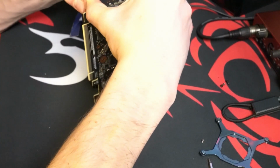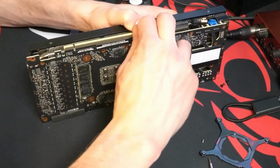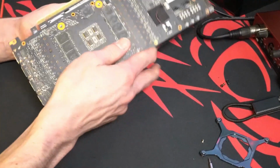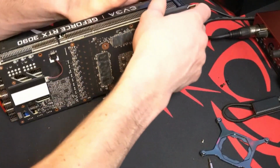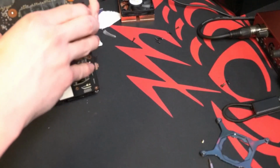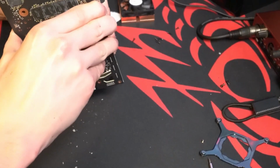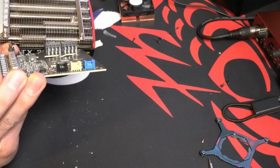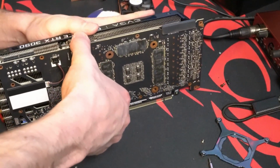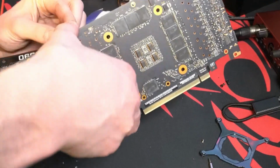And you're gonna notice there's a cable. Once you get this thing apart, you might be able to unplug it while it's together still. But when you pull it apart, don't pull it apart aggressively. Look for that cable and unplug that. You'll see me do it. I do it after I get the card detached from the heatsink. There's that little wire. You see that? The middle left of the screen. It's black. I'm unplugging it right now. There we go.